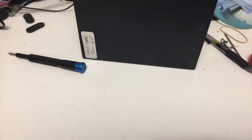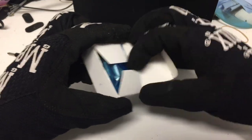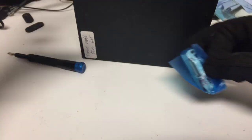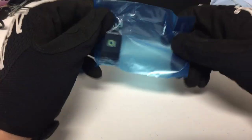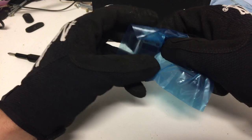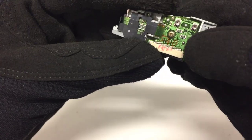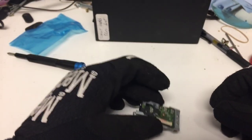Most likely you'll need a soldering iron and soldering wick depending on what company you order the laser from. So when you get the lasers, oftentimes they have a small blob of solder on them which will prevent the laser from reading discs. See this little blob of solder right there — you're going to want to take that off.